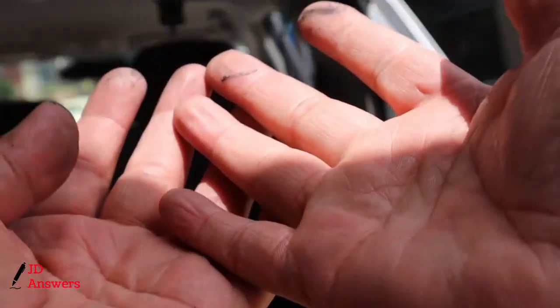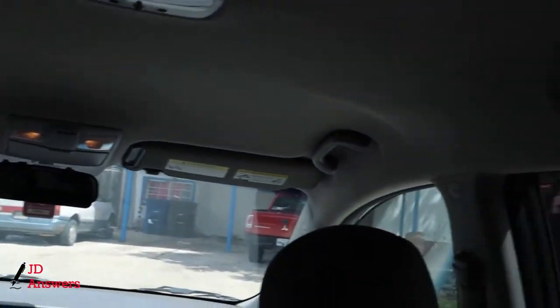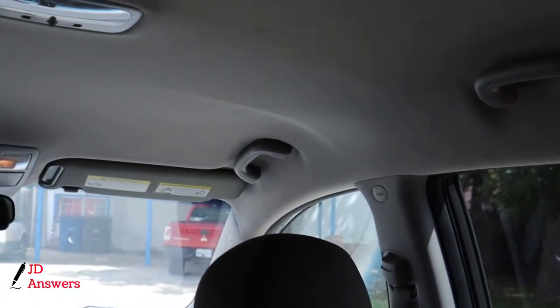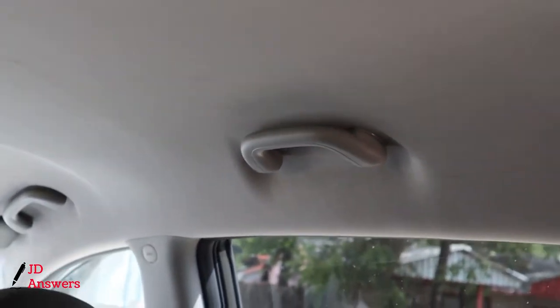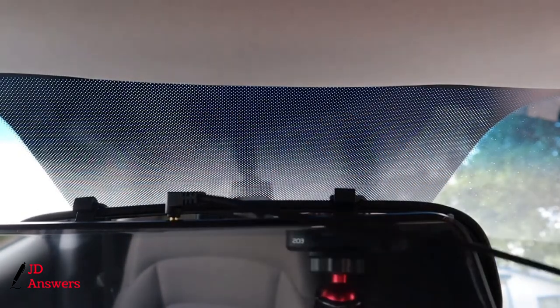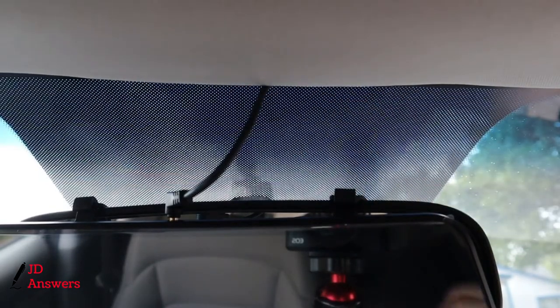Now we just have to go to the inside. This is a good opportunity to start washing your hands, because when you start touching the upholstery on the headliner you want to make sure your hands are clean. So we're right here — before we move on any further, I'm going to go ahead and start the installation from the front dash cam, that way any slack will be over here towards the back area. In the front, as you can see on the B-column, there's an airbag, and an airbag in the front A-pillar right back here, so we want to install the slack right underneath that handle so none of this wire is going to get caught in those airbag areas. I'm back at the front — I'm going to install the rear camera wire to the dash cam, and with my fingers I'm simply just going to push it into the wire into the headliner. There you go — see how simple that is.